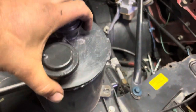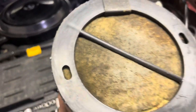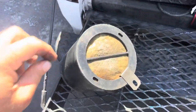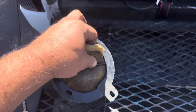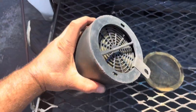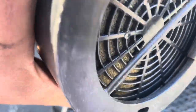So here's our charcoal canister. Two screws — clips and screws. And then we've got this little filter here, which is obviously stinky. Smells like fuel, nasty. I'm going to take this over to the tailgate and show you guys how to do this. So first act of shenanigans here is pulling this filter out. This is the original filter — it's obviously seen better days. You can see we've got this mesh in here.